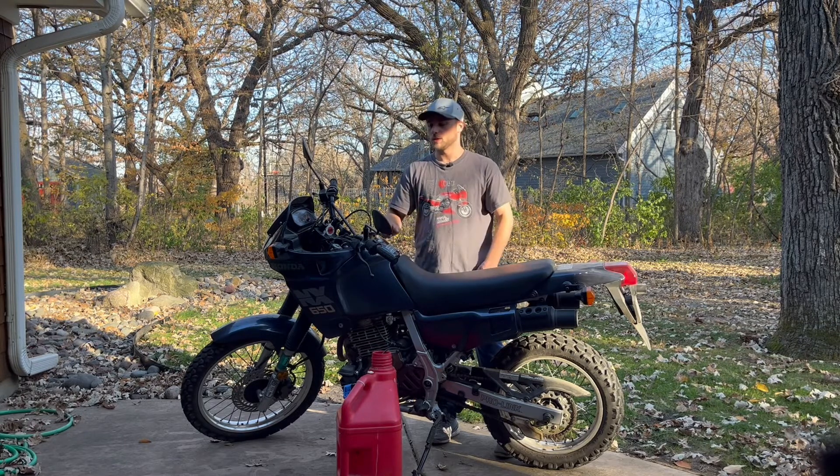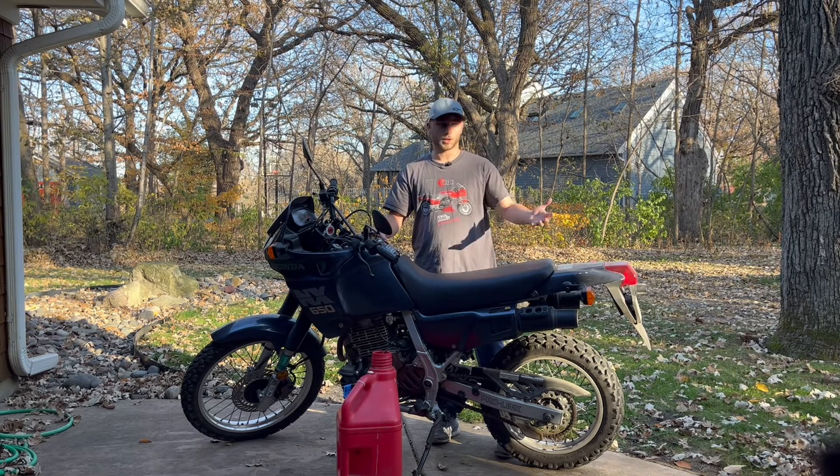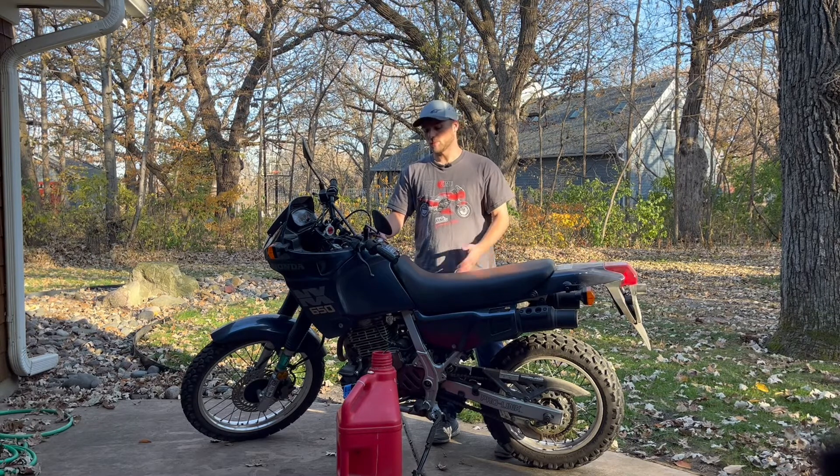In a motorcycle, that's not quite the case. We've got really small gas tanks, so we've got to be careful of what we're putting in them. Even just a little bit of ethanol fuel is enough to taint our gas. If the previous person used that pump with 91 ethanol fuel, even if you switch to non-oxy, you're pumping their old gas first. I've pumped that first five gallons into my truck before filling the bike — that's a band-aid way to do it. Really you want to avoid that, and we keep gallons of non-oxy fuel on hand so we don't get in that situation.